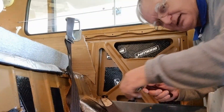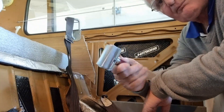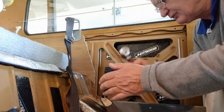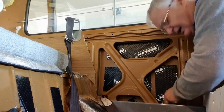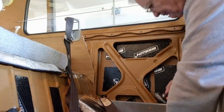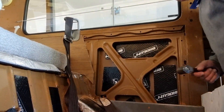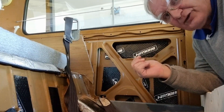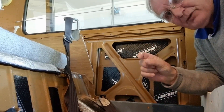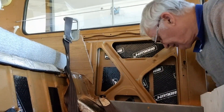I'm trying not to move the vehicle too much because the screen keeps shaking. However, I've got my roller - it's a nice steel roller, quite strong. I'm just going to push these in. Now, time for me to put some insulation over the top. It's a 10mm pro-cell insulation, foil on one side, sticky on the other, and we will stick that on top of this dead matting here and fill up that cavity a bit.